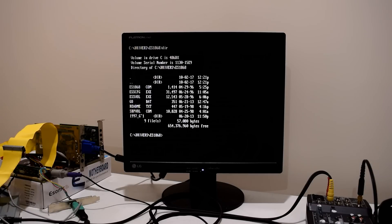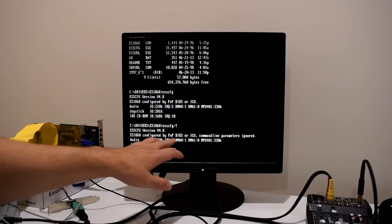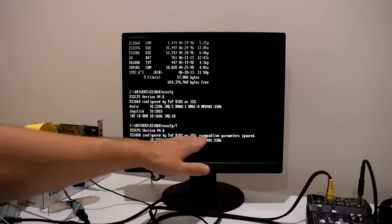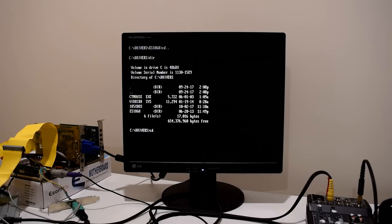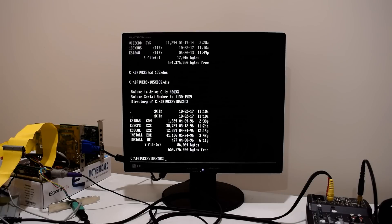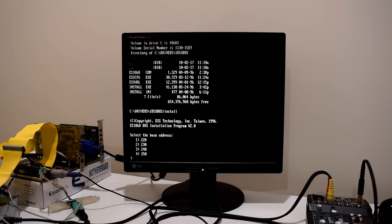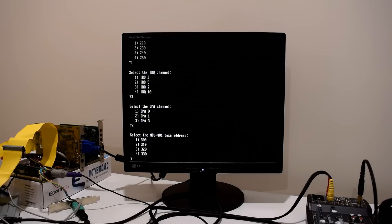There are a couple of drivers out there. I first had a go at using the drivers from the Vogons website, however everything seems to be working fine at first, but if you actually want to change some of the resources it just says you've got a plug and play BIOS, so you have to use ICU software or whatever, and the command line options are ignored. I actually found much better drivers on the BTC website — they made old sound cards back in the day, and that's got a nice installer. So basically you just run install and it asks you what resources you want. We're going to go with address 220, interrupt 7, DMA channel 1, and the MPU-401 interface on address 330, and enable the joystick.